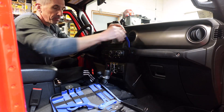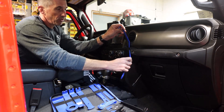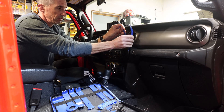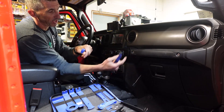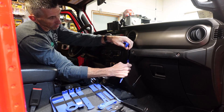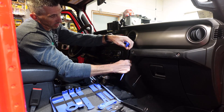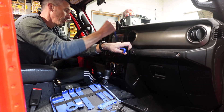I just turn it like a key almost, and as you do, it opens up a little bit more. Take a second tool and work it like a crowbar, just nice and slow. There you go — then you just work your way around. So now that stays out, you can see the gap, and I just keep going down the opening. As you go down and turn it just a little at a time, you'll feel each clip start to come loose.